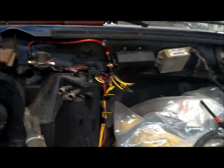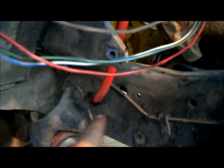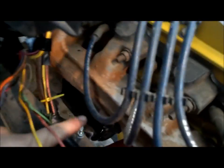I've done quite a bit of wiring since the last update. The main fuse box is wired in — the main battery lead comes from the frame and runs up to the fuse box. I have a wire going to the starter solenoid mounted on the firewall, and then wire from that going down to the starter. The alternator is wired in with the main power feed going up to a fuse.